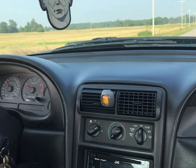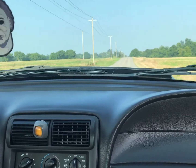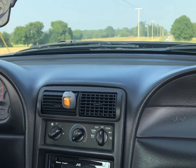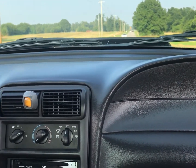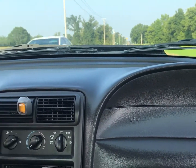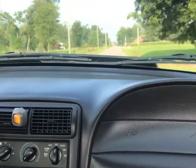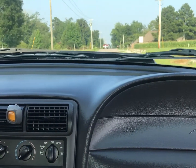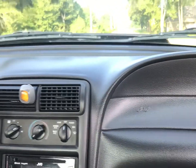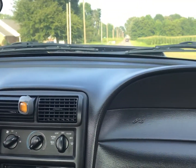55 with the windows down, turning about 1900 RPM. It's got a 3.73 gear, 4-speed automatic with overdrive. It doesn't drone too bad with the windows down. We can give it a little pedal one time and drop it down a couple gears. This car always surprises me — when you just drive these mod motors easy, they don't have much bottom end and kind of feel a little weak. But once they get past 3500, they just spring to life and take off.